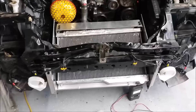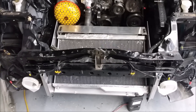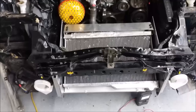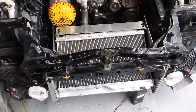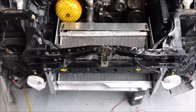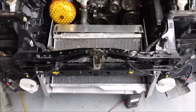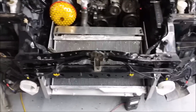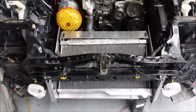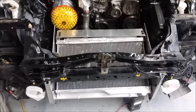I was going to weld a lot of this, but every car is slightly different and there isn't much play when you start welding. By using bolts and retaining nuts — like a jigsaw puzzle — we've got flexibility: maybe a millimeter of movement on each nut, so we can tweak it and make it perfect for your car. If you ever need to change a part, you can just pull that plate out, put a new one in, screw it down — no convoluted parts to manufacture. It's really low maintenance and easy to deal with.